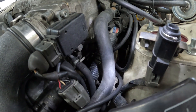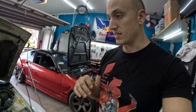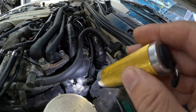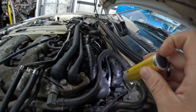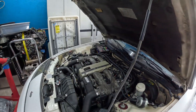If you're taking on a project car like this, I would highly suggest you just slowly replace all your vacuum lines. It's not a sexy car mod or a cool thing to do, but it will help with drivability issues and keep your car running nicely. Back here we've also got our idle air control valve — this is why the 300ZX gets a bad rap, because look how buried everything is. Make sure all your lines hooked up to that are good, and the electrical connectors too.